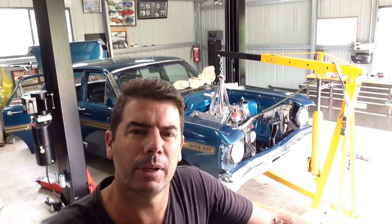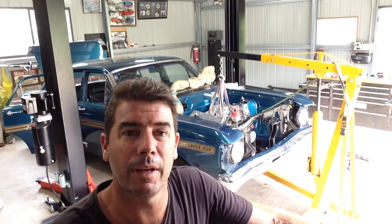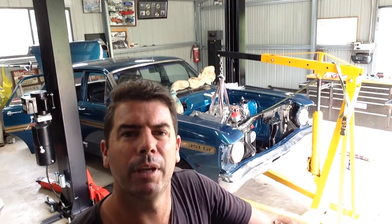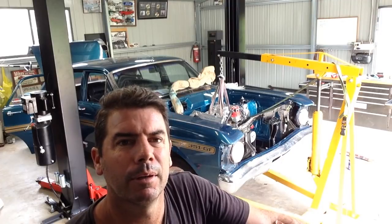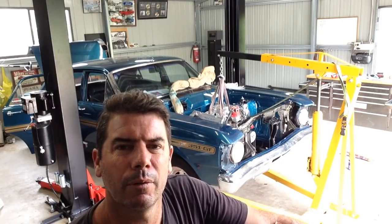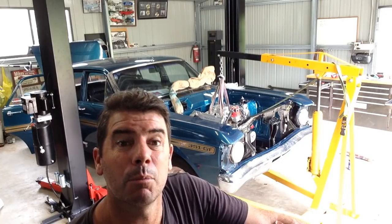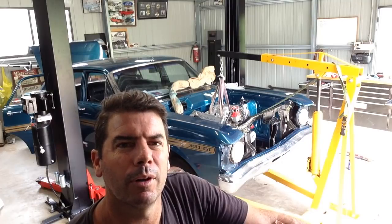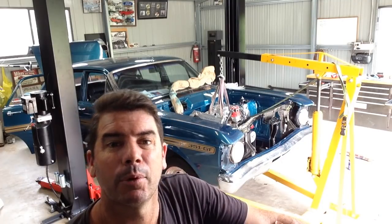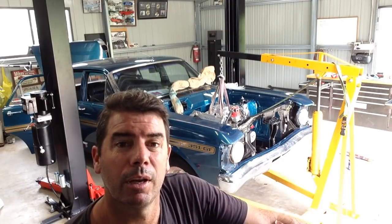So our first hurdle was you had to clock the starter motor. The second hurdle was the C4 dipstick tube on the headers. And you may have seen I had to take a hammer to my brand new headers, and I'll probably need blue can therapy for that, a hug later. But anyway, it's continued. I've got the motor in there on its own, and the sump hits everywhere on the cross member. It's Friday afternoon. I'm not going to be able to get anything overnight, so we're just going to butcher it. I'll have to modify it because I want to spend the rest of the weekend fitting everything else up. If I'm waiting for a sump, there's not much else I can do. So we'll rip it out, drop it off, butcher it, get it back in.